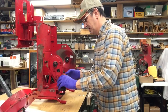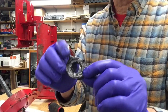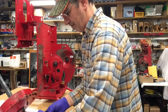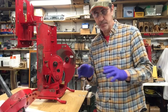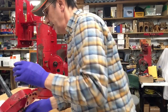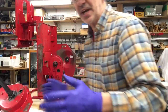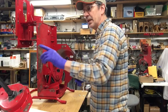Here's my thrust washer, and it only has about three of the teeth left that are supposed to snap into the shaft. We'll clean all this stuff up in the mineral spirits and throw the boots away. When I rebuild this, I'm putting all new stuff in it. The hexagon shaft will be new. This cover—you can see the hole through it—that is from all of the side play, so the cover will have to be replaced. I have three or four of them, no problem. The hexagon tube will be new.